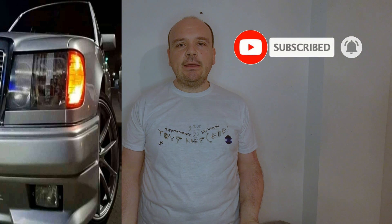Hi! Happy Mercedesing! In today's video we're going to be talking about pressure loss. You've seen my previous video where I was showing you how to measure your pressures. Now I want to show you that we must make a difference between two pressures — not just system pressure and control pressure, but also the pressure when the engine is on versus when the engine is off. Our topic for today is the pressure when the engine is off. As the engine is off, we must maintain the pressure that is built in order for the car to start easier.